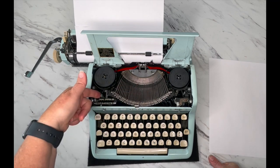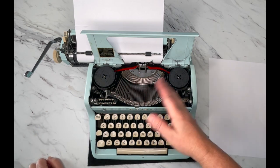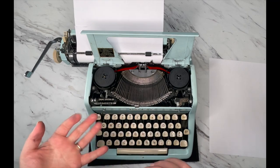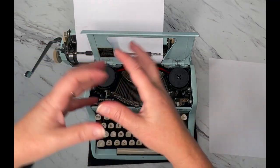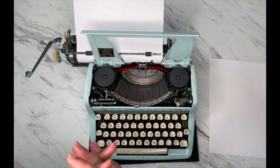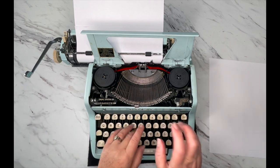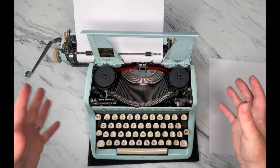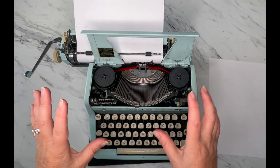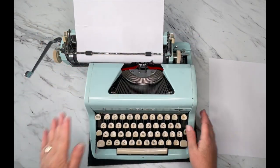To manually reverse your ribbon, there's a ribbon reversal switch right here — just go back and forth. There's a lot of ink on that ribbon, so when it gets to the end of the spool it's not the end of the ink — just reverse it. Some ribbons will auto-reverse, but if you're typing along and the keys feel very stiff or the font looks really faint, stop typing and always check your ribbon reversal before you do anything. That solves most typewriter issues. Your color selector is right here — you've got red and black. The white is a stencil option and you're not going to use that; your typewriter won't work properly if you use the white.